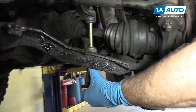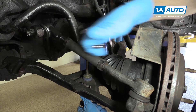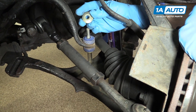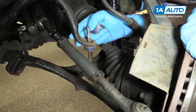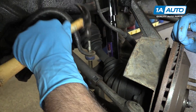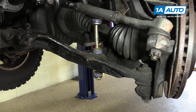So we're going to use a 14mm on the head of the bolt down below. We're going to use a 14mm on the top — it may vary on your application. I'm going to go ahead and remove this nut here. Now this does come off in stages. You have your main washer, you have your rubber or poly bushing, then obviously you have the sway bar link here, or the sway bar itself — anti-sway bar. I'm going to try and just tap this down, and this bolt will slide out through the bottom. What we don't want to lose is all these components in the middle here — we're going to show you what those do.